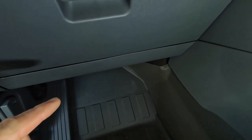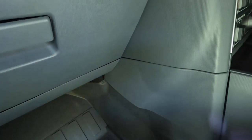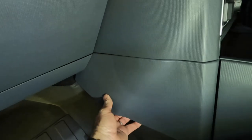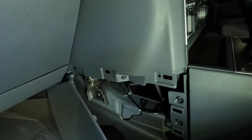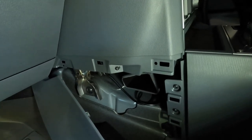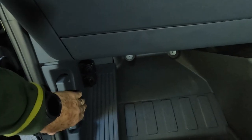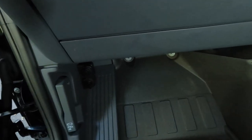I've connected the microphone cable to that unit, which runs across and behind this panel here. Don't be worried about taking that panel off — it unclips very easily like so. Take that off and you can see the cable to the microphone running there; it goes across to the other side. I've also run power from the unit across to the footwell power outlets. I'll talk about that in a separate video on how I did that.